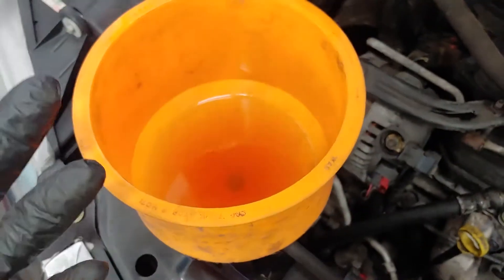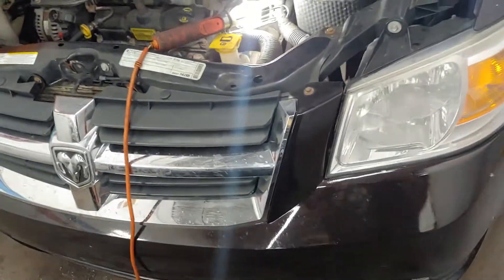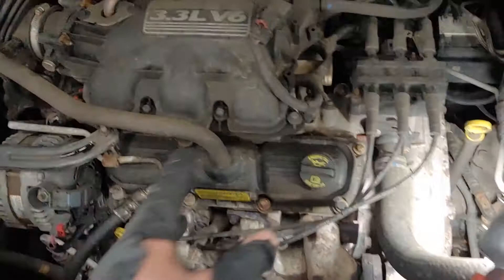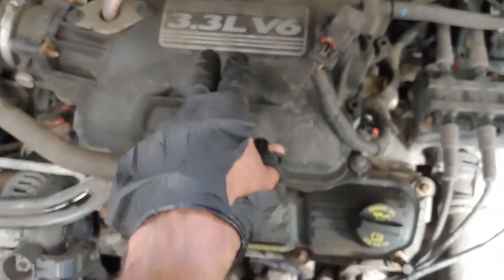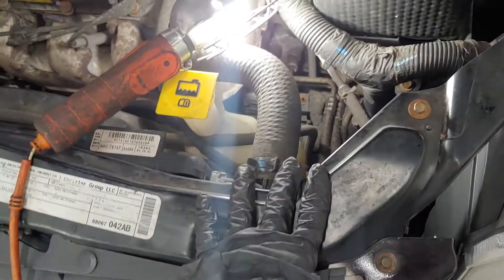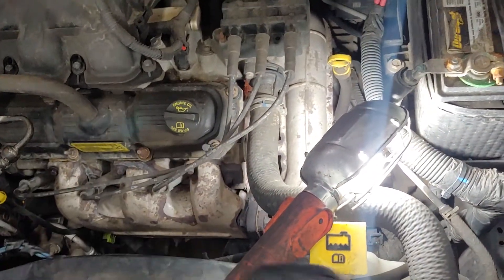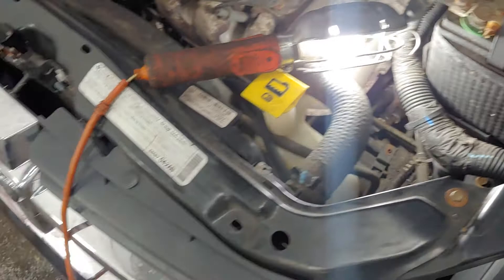The vehicle overheats and it starts boiling. Now after replacing this relay, at roughly around 220 Fahrenheit degrees, that's when the fan is going to kick in. Again, this is a 2010 Dodge Grand Caravan or Chrysler Town and Country. A lot of these engines that are 3.3 — I'm not sure about the 3.8 or the 4.0 — but I just wanted to mention and show this on the video for people that are having issues or may have similar issues. Thanks for watching.